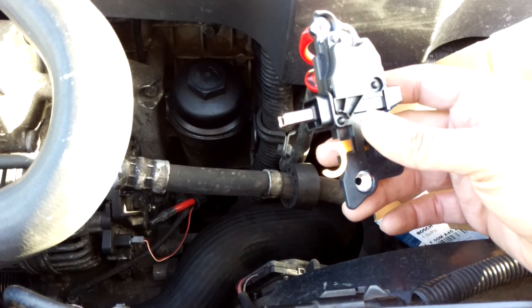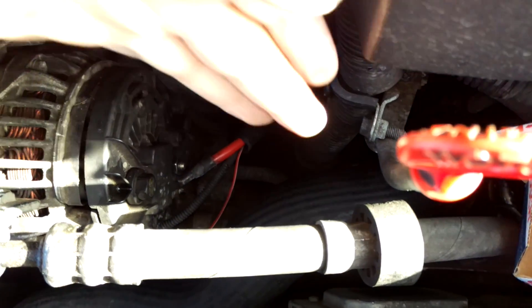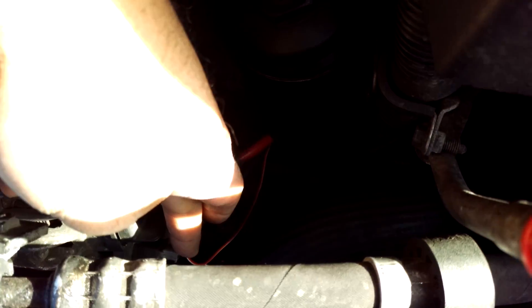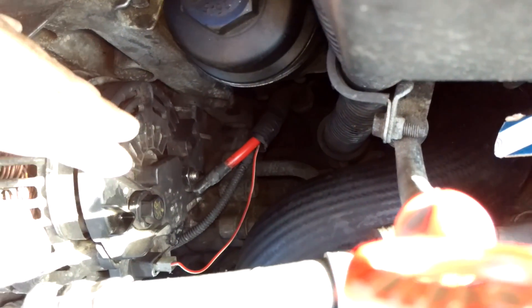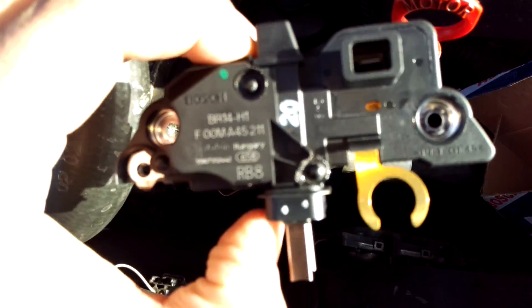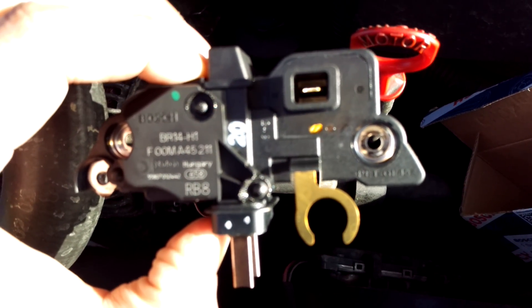On this alternator it's pretty straightforward. I'm going to work my way down through the layers — I'll need to take off this lead here, which is a permanent live, so I would strongly recommend disconnecting your battery negative before you start doing any of this. I'm actually going to protect it with a rubber sheath. I'll be disconnecting that wire there and then I can get access to all the screws and bolts — there are no Torx bits or anything fancy, it's all just Phillips head screws.